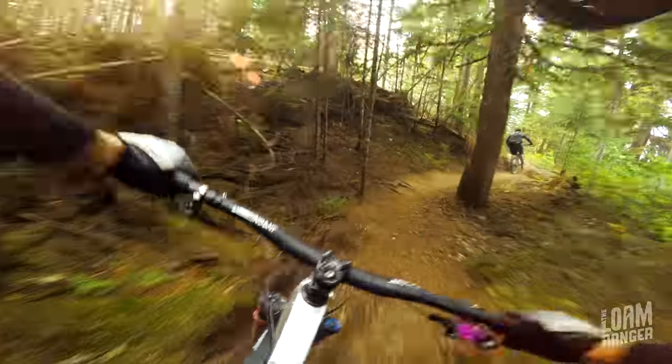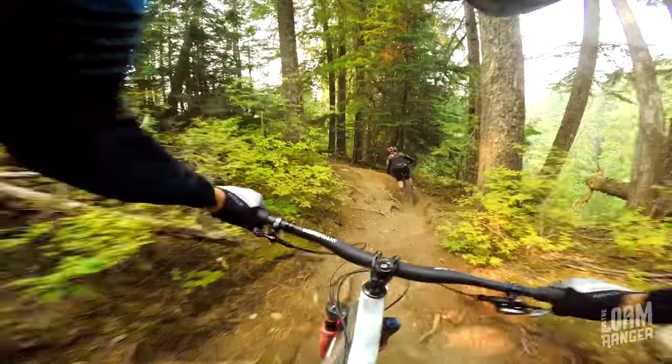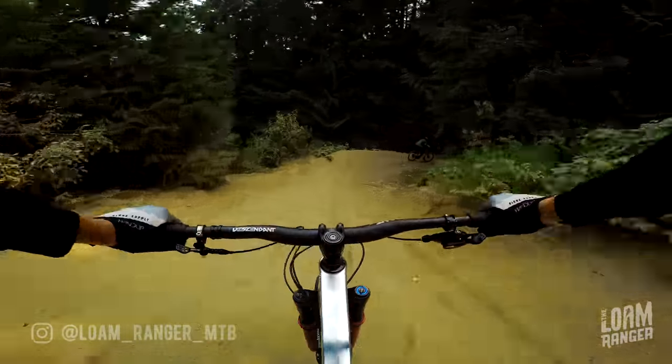I didn't do too much or really any setup at all with my suspension. I just set the sag and I was off, trusting the standard tune that came on the bike. But in the front, I did notice that the Lyric tended to bog down a little bit, even with a relatively fast rebound setting. I recently read a review from Pinkbike saying the very same thing about the fork, which is interesting. Of course, this is only when you're going really, really fast over really chattery stuff. I notice it almost sinking down and staying there. So it might take a little more tuning with the fork to get used to it. But as far as the really rough technical stuff, if that's the only thing I have to report, I'm doing pretty good.